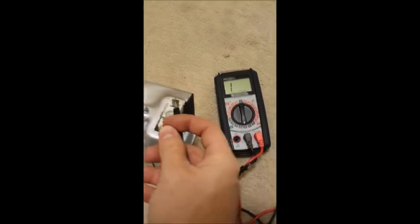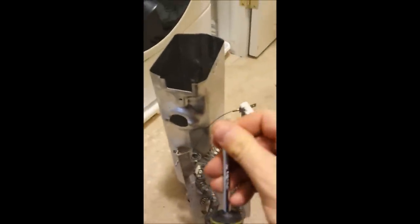There is no change - we have no continuity for the heating element. So I think that might be our issue. To remove the heating element we need to remove this screw and pull it out. I pulled out the heating element from the heat shield - it was a little bit difficult. I had to really pull from this end and use a flathead screwdriver to push, wearing gloves of course, to pull it all out because you can get cut on this metal. I found it - it's a mechanical break in the coil. This coil is definitely burned out, and that is definitely the problem.